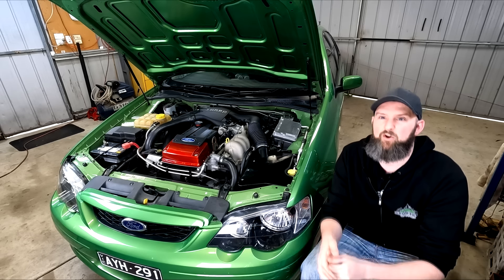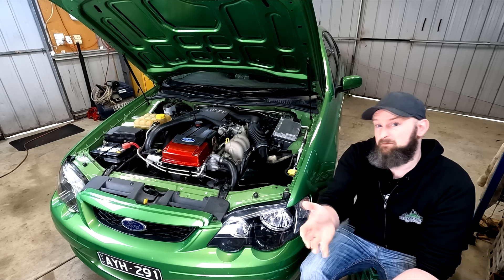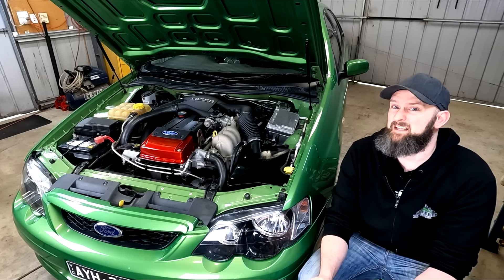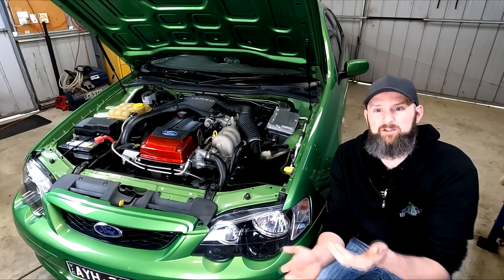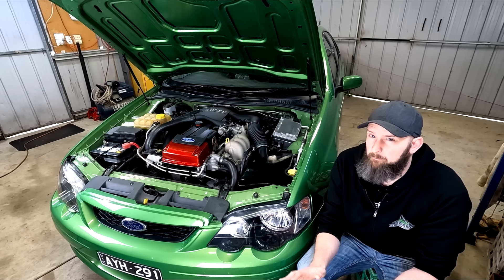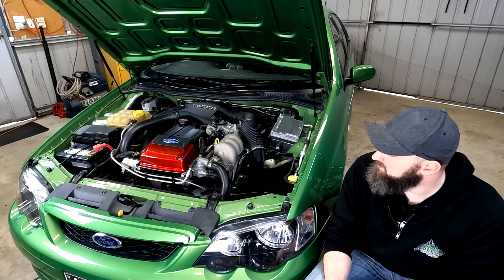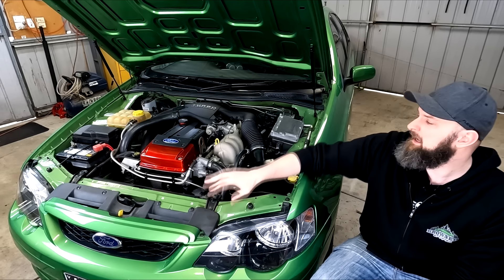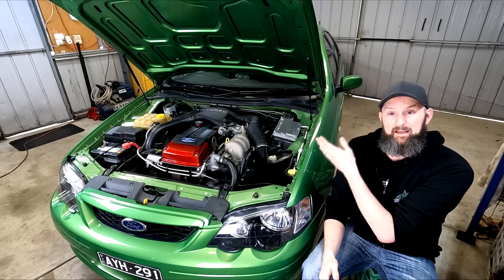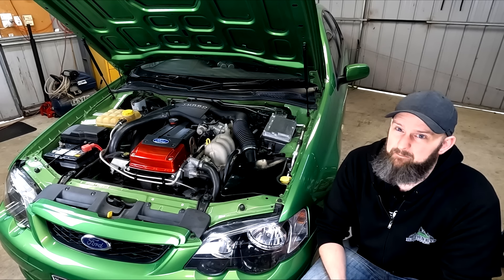So, would I do this conversion again? And what's the future of the car? Yes, I would certainly do this again, and it seems inevitable that we'll go for some more power sooner or later. I would ideally like to do that by putting in a factory turbo ECU so we can have proper boost control, then throw some injectors and valve springs in and turn it up. While we upgrade to some legit intercooler and piping kit, which would also tidy up the engine bay a bit. Maybe we upgrade the dump and cat while we're in there because they're the sort of restrictive parts on the exhaust. Endless from here really — the next step up is largely just how much you want to spend.